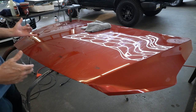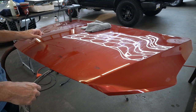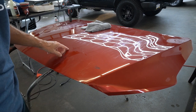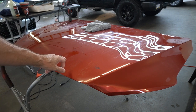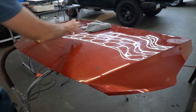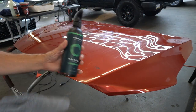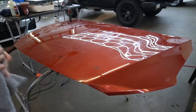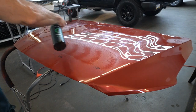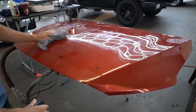Now, let me take a look at this and just eyeball it. I'll explain what I see first, and I'll have you take a look. Blazed through the 2000, the 1500 grit, the 1200 grit. Did very well through all of these sections. So let me grab the panel prep one more time. Make sure that we're not just filling these sand marks, that we're actually correcting them.